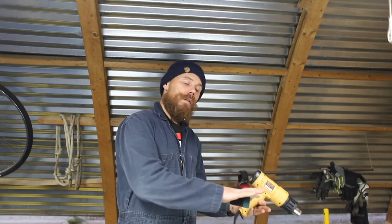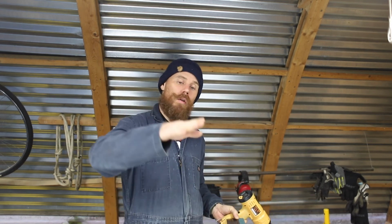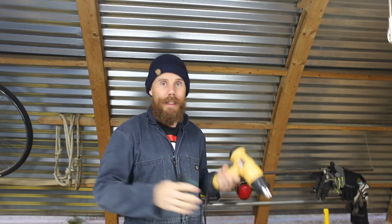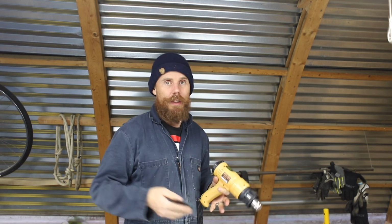I'm filming now. All right, Zach, we are at an inflection point where we have to make a decision. And right now you think maybe we can still salvage this. Tell us what you're gonna try. Maybe. I don't know. So, I figured we would get it pretty flat over the whole thing, and then where the ridges were, we would heat it and push it in and stretch it in.